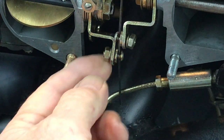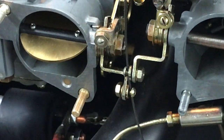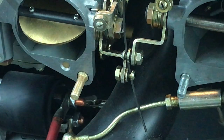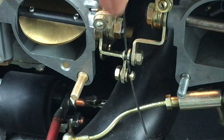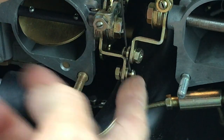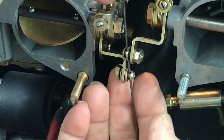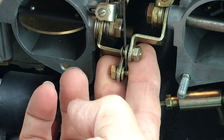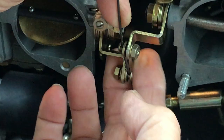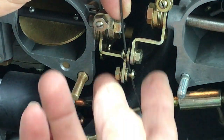This is how the choke works: you've got what I call the binding screws, one here and one here. Notice the heads are towards the center where the cable is — that's the piano wire. The air log is in place, the cable comes down, and the wire goes down the rest of the way and ties into the two choke levers. The fun part is this wire wants to move straight up and down, but it's actually moving the levers in an arc, so it deforms slightly — there's enough play in the wire for that.